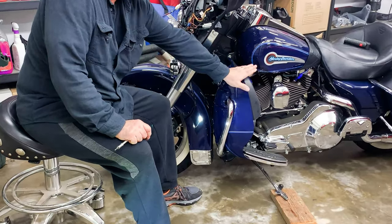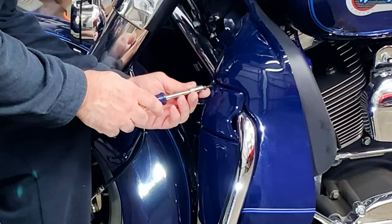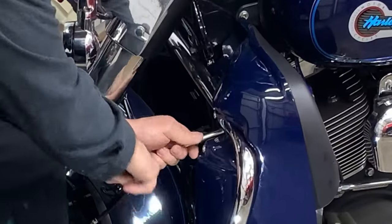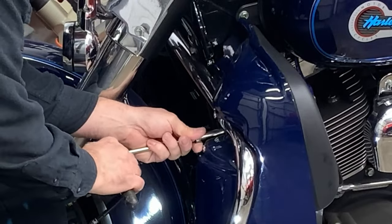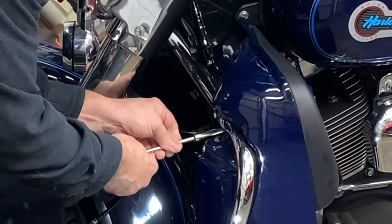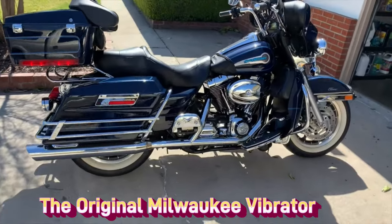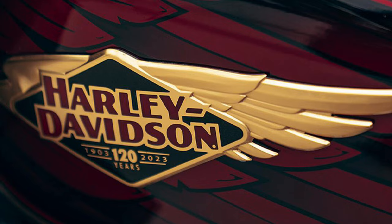For the plug block removal, the front cover needs to be taken off, which exposes two bolts connected to a U-clamp clamped on the engine guard — these are small Torx screws. The two bolts on the U-clamp are 7/16 nuts. Once those two bolts are removed, that's pretty much what holds the fairing on. There is one more bolt down below on a clamp. Harley doesn't use a lot of bolts, and you'd think with the vibration a V-twin generates it would be the other way around.